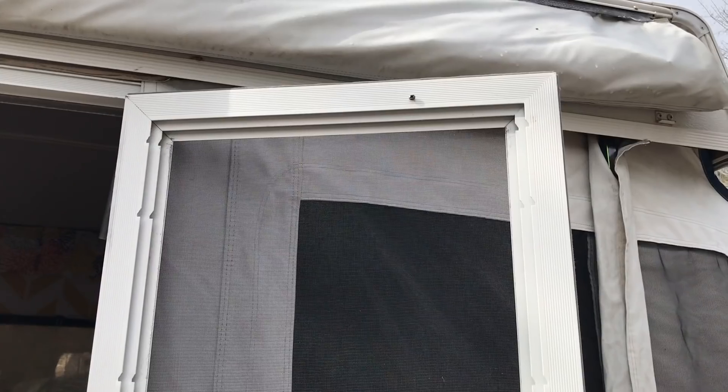I think the most important part is your cables. They're kind of hidden — on the inside corners of your pop-up — and they make the roof go up and down. It's basically four pulleys, a winch, and some springs. If those cables pop, you won't be able to open the camper, and it can be expensive and time-consuming to fix. Most sellers won't remove all the cupboards to let you see them, but on day one when you get it, open the cabinets and lubricate everything as best you can. If the cable looks really bad, go ahead and fix it — you don't want the cables to pop and ruin your weekend at the campsite.